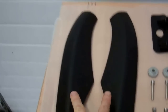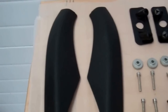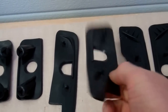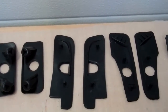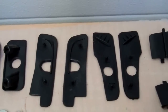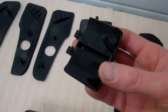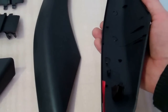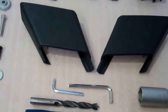You've got a series of plastic covers which clip into the roof bars when you've fitted them. There are some rubber gaskets that go on the bottom of the mounting feet - three mounting feet on each bar, so you've got a pair of gaskets for each. These little plastic bits clip into the underside of that cross member, and there are covers that clip onto the front corners of the roof bar - these are the side plastic covers.